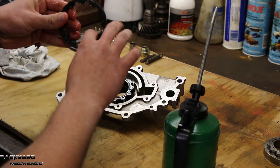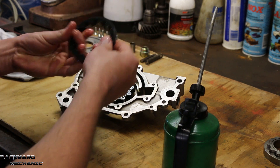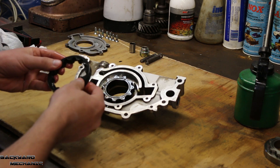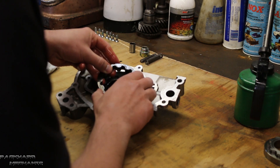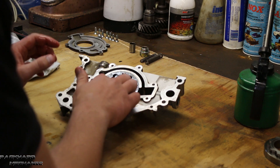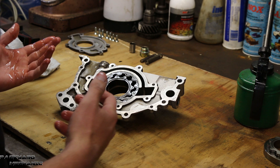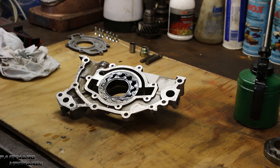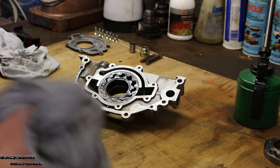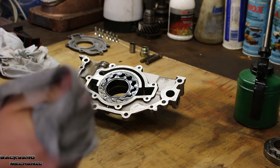We're going to lube up the gear — plenty of oil, just layer it. You never have too much oil. It's very important putting things back together to make sure it's got enough oil in it. Now we'll get the driven gear. It will slide in like that — now that's installed. Now we will put the oil control valve on. Again, oiling down here, oil up here, oil in the threads — you want to oil this all up.